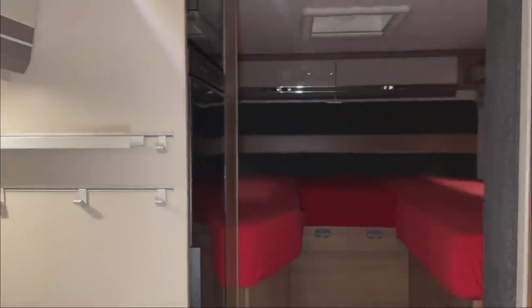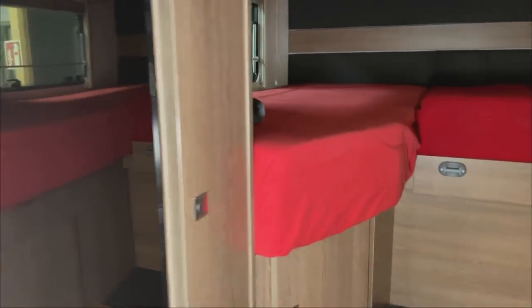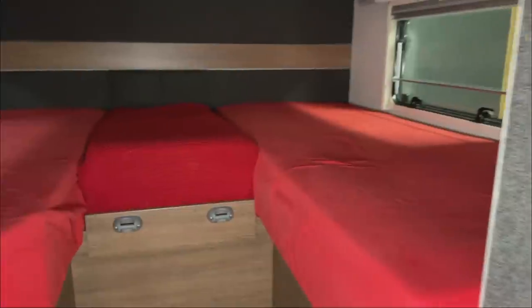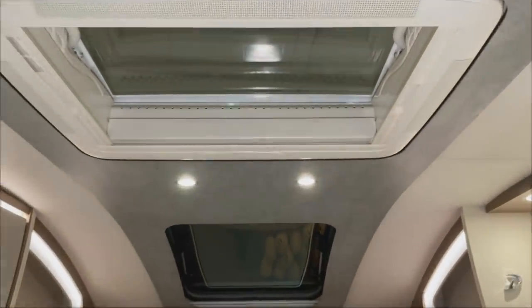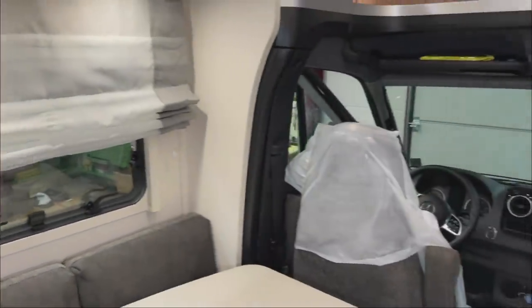Then we have the sleeping area back here — we haven't changed much there. Of course you just need to switch our mains priority switch, which I've shown you. We routed that out from the nice cabinet at the back. We also installed an additional RCD (FI) there, because when you connect an inverter, you need an additional RCD. Then at the windows you can see everywhere the magnetic contacts from the Vibro alarm. All the windows have been secured.